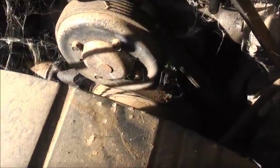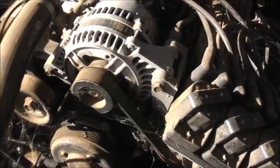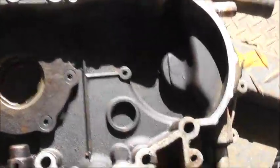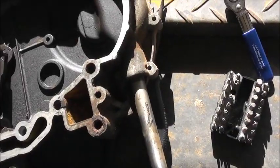This whole assembly here is what you normally see - this aluminium assembly. Water hose comes out there, bolts on the front. This engine happens to have a brand new water pump on this one. It's just not worth fixing those engines once a bearing spins. You've got to get oversized bearings, get the crank reground - it's just not worth it. Too much money, especially for those engines.